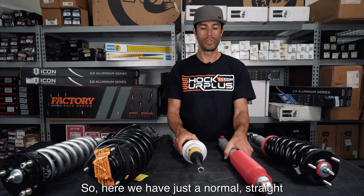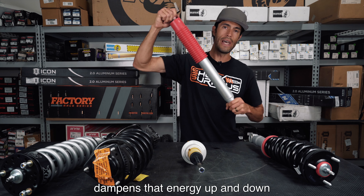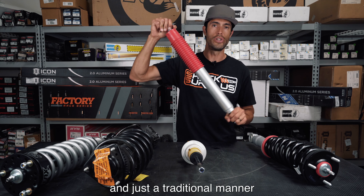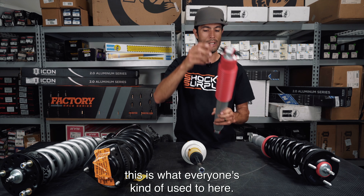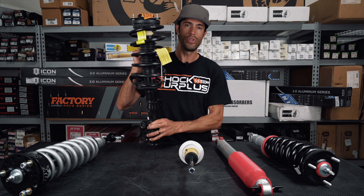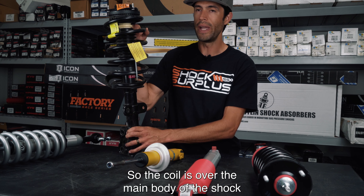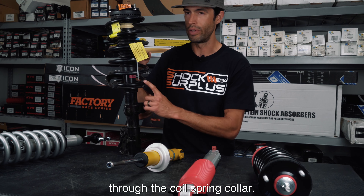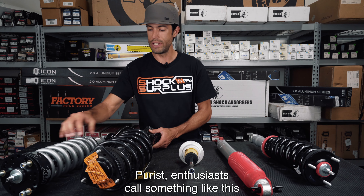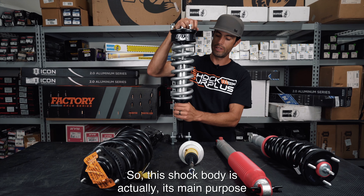Typically, KYB will sell the strut by itself without the coil spring and without the top hat. This is just more of a convenience factor on some applications where you get it all in one. More traditionally, you're going to buy a strut by itself. This is a Bilstein strut — it's basically a shock absorber by itself, but it becomes a strut when you put the coil spring collar and coil spring on it. You can see there is a small snap ring groove that holds the coil spring collar, which holds the coil spring and supports the weight of your vehicle. Yes, it's strong enough — we get that question a lot. They have tremendous R&D, so you can be confident in that piece holding it.